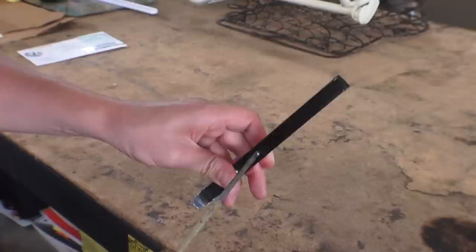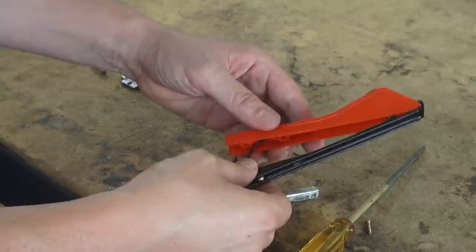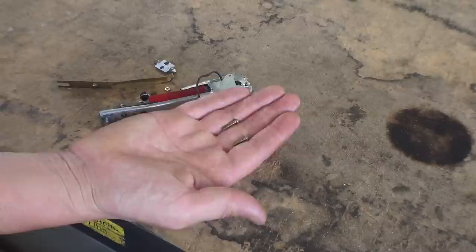The bulb is right there, usually in the front, and there's a bulb holder that holds it in place. These early semaphores have a nut on the bottom and two screws on top that hold everything in place — you'll want to undo those. The later style just has one or two screws on the bottom. Take the top piece off, take the bulb holder out, the lens will come apart, and you'll see how it's all put together. There's the bulb that falls out — that's what we're going to replace.